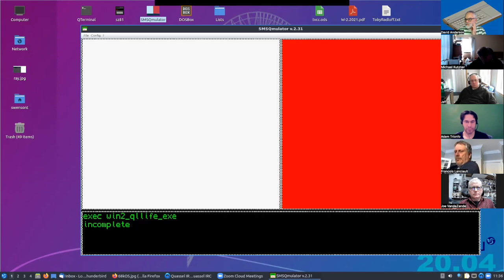You can buy almost everything QL-wise on eBay. The prices are kind of steep. Almost all of them come from the UK. If you wanted to buy one, I would recommend getting a US-based system. It runs better. It's physically built better. It's designed to run in the US. The British use a British Telecom connector for serial ports. The US version uses the standard 9-pin D. Much better to get the US one, but the ones you may find online may be British based because they're being sold in the UK.